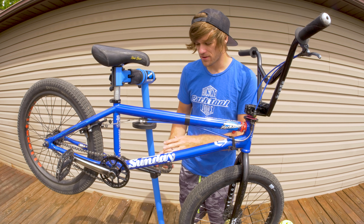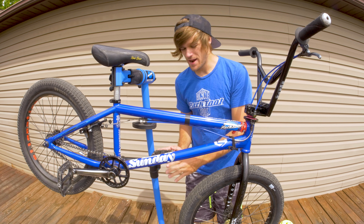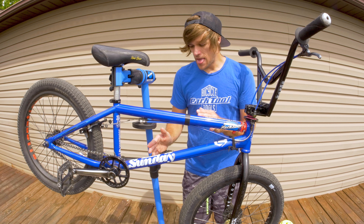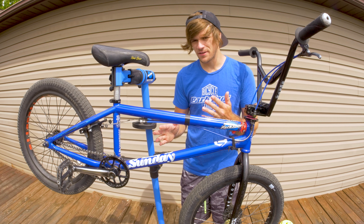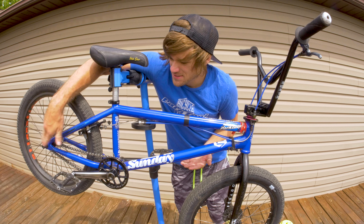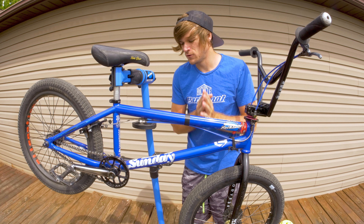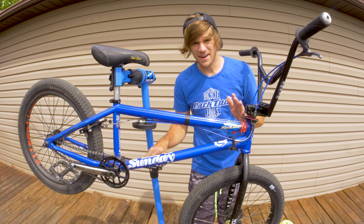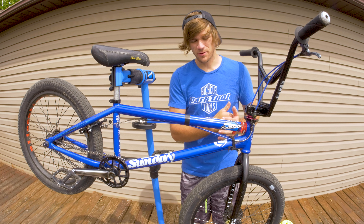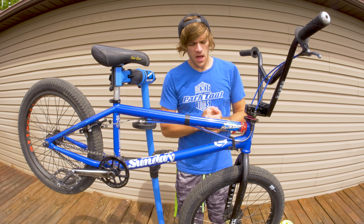You can watch the in-depth videos for the deep nuances, but let's talk about cranks. The length of your cranks is up to you — essentially, a longer crank gives you more torque when pedaling, while a shorter crank gives you less torque with the same force. There's also the effect on your feet hitting your pegs: if you're a taller person with bigger feet, a longer crank length might mean you're constantly hitting your pegs with your feet, which is a very big deal for a lot of people who have to deal with that.